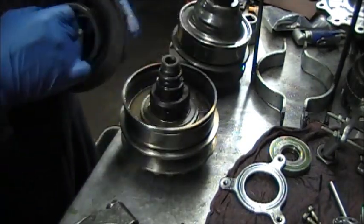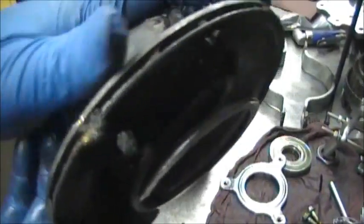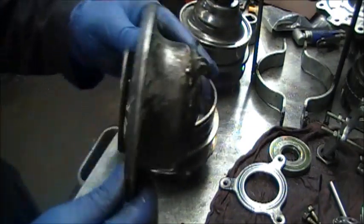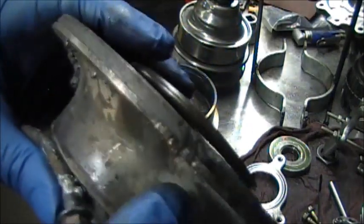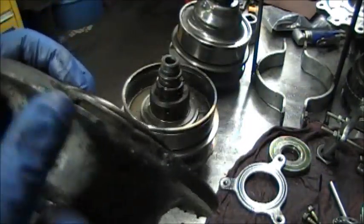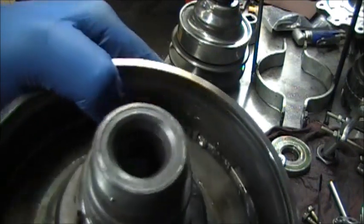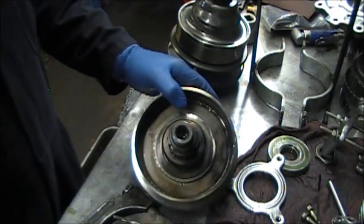This piston has a spring in there — there's the spring. The spring comes out, but this one is welded in because I cut it. The drum was cut right here, and you can see the damage here. The inside of this drum was scored — you can see the scoring around the edges.